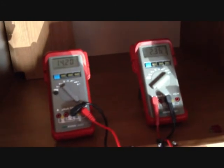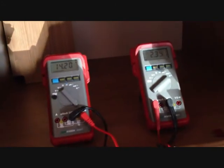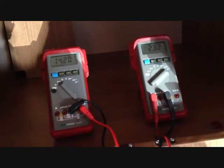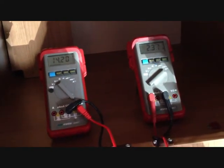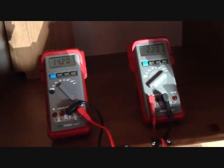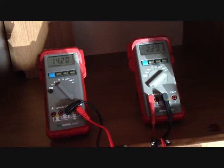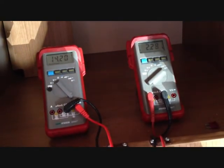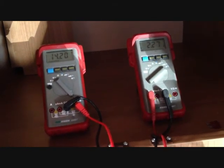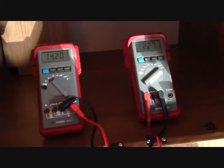I've changed the meter on the right hand side to give an amp reading. You can see that there's 2.3 amps flowing into the engine battery from the leisure battery. This will only occur once the battery voltage is raised over 13.3 volts. This is more than adequate charge to cover any loads from an alarm system or tracker that may discharge your battery while in storage.